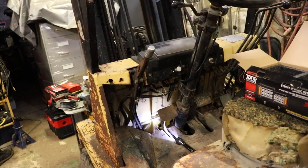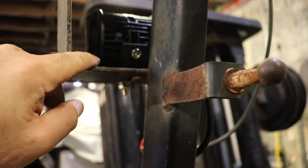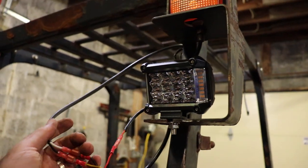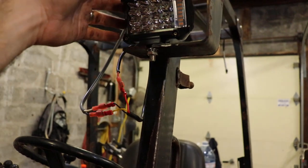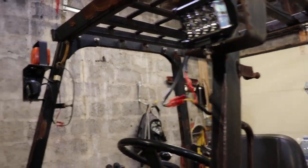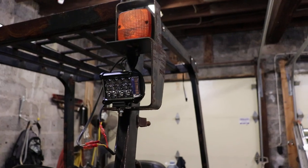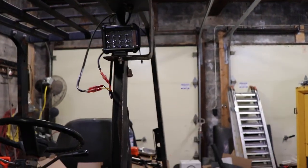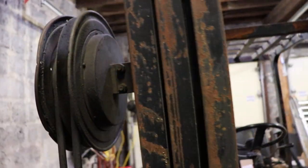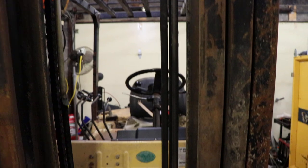I haven't really used this too much. I noticed the mounting screws — some of them were polluted with epoxy, so you had to pick which one went on which side based on which screw you could actually access. Wiring isn't tidy yet; I still have to go over that. It would be nice to have a better connector — the three loose wires are adequate but could be better. On a forklift you always want to keep your lights protected because you're going into locations the width of a pallet, so nothing can stick out or it'll get smashed off. That's why I angled one to the side — but I think that's good enough, so thank you for watching.